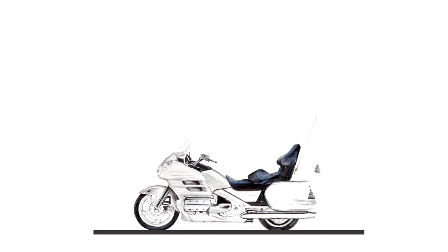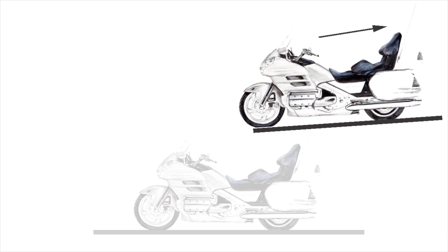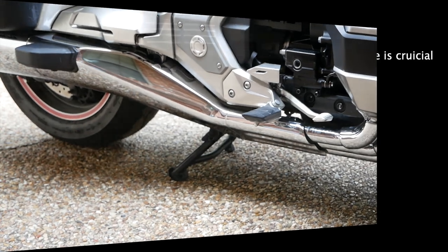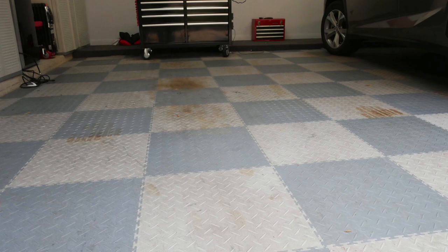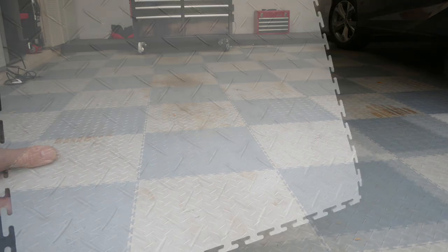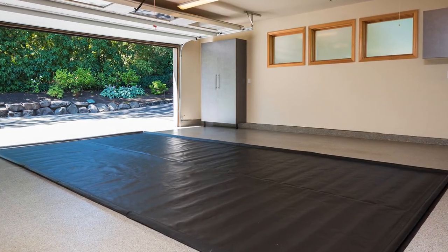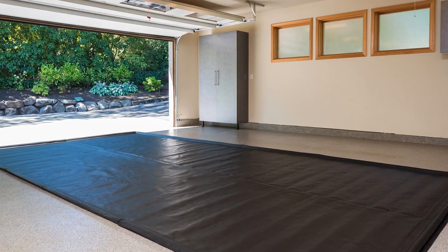It's extremely important that your motorcycle be on a flat level surface. If your motorcycle is at a decline you'll never have enough energy to get the bike up on the center stand. If it's on an incline you'll easily get it up but you'll never be able to get it back off. You should also work on a hard flat surface — even thin rubber tiles on a garage floor absorb some energy and can make it more difficult or even impossible to get the motorcycle up on the center stand.